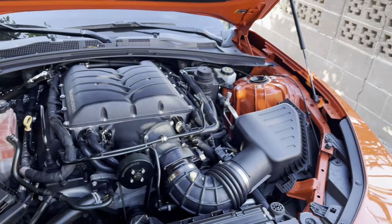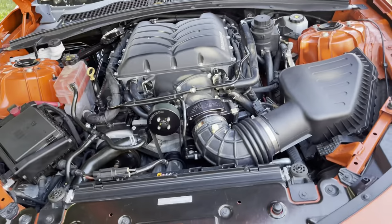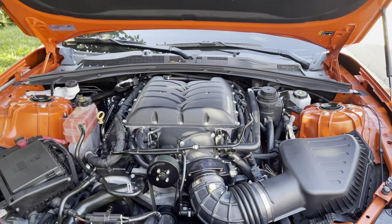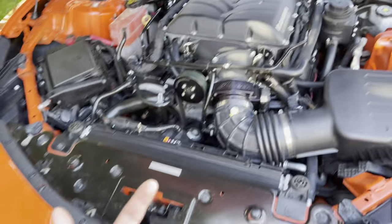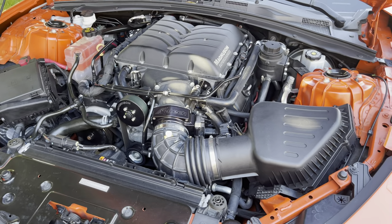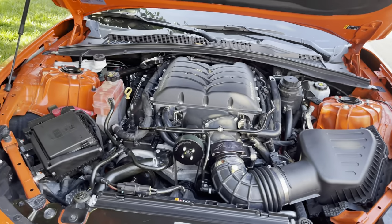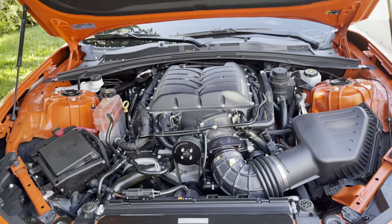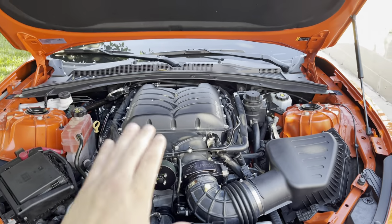So, the bad news guys, sorry about that. The bad news is, the RotoFab Big Gulp unfortunately did not work with this setup. So how this beast is sitting right now, it is completely maxed out the whole LT1 fuel system. So with that being said, guys, now we're debating either getting the stock LT4 injectors or the 32% overflow on the stock LT4 injectors. So with that being said, the bigger one, the aftermarket big boy injectors. We don't know which ones to run yet. I mean, the price tag on them are quite a big difference, but if we run the stock LT4 injectors, we're going to be limited to about, I want to say 650, maybe I'm wrong, just because this one doesn't have a cam.